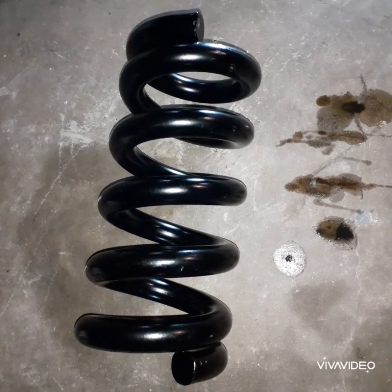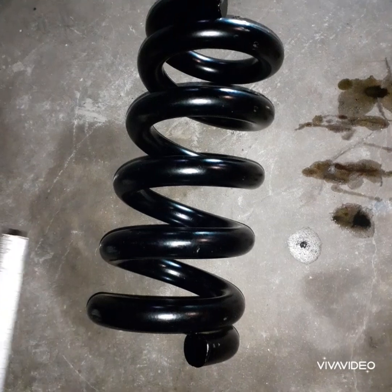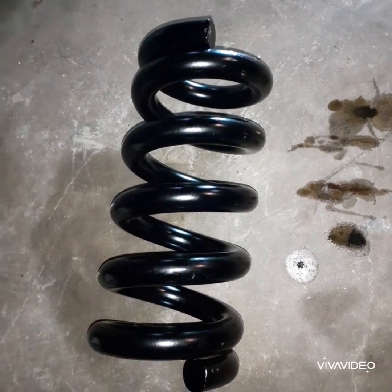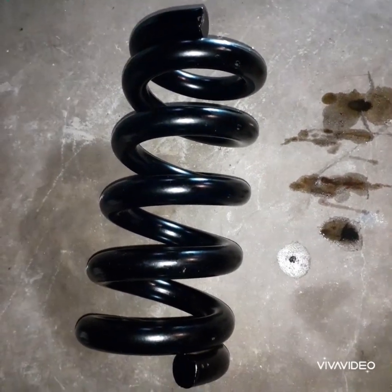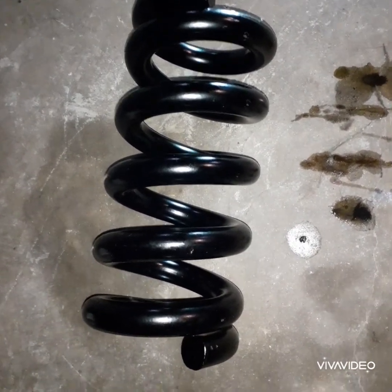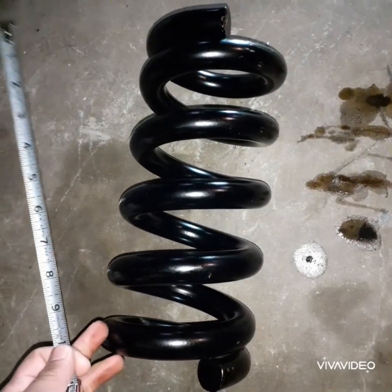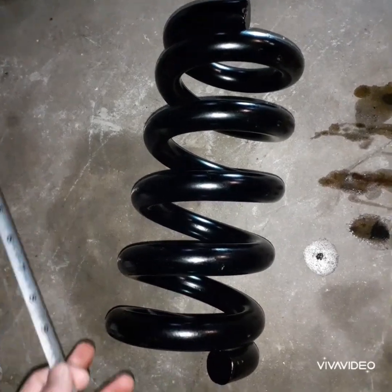I know some guys in the hopping game, that's all they use is from High Hitter, you know, hydraulic springs. Everybody's different. Everybody tries out different springs to see what they like. And I heard good news about it, so I'm going to use them. I'm going to try them and see how they work in my car. And roll this one out of the way. This is full stack, so I am going to shorten this one up. I'll probably be cutting about a coil and a half off of this one later on today.